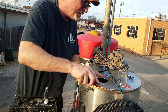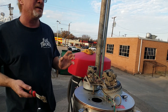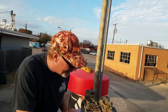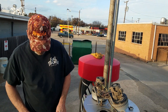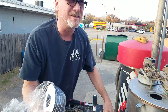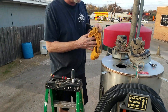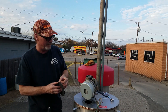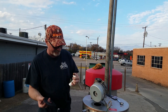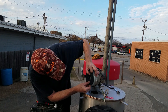These vacuum motors are sucking good, so we're not going to change the motors. Generally we change the packing in here. These motors are $35 each, or you can buy the packing kits and brush kits and get two or three runs out of your motor rather than just throwing it away. Buy these in 10-packs because if you have four vacuums, you're going to need to change them every so often. It's always best to turn the power off — I don't have the power off on this unit, but it's best practice, and I don't suggest most people do it without the power off.